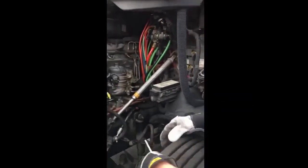My front and back spring mounts are properly mounted and secured - not cracked, bent, or broken, not missing any hardware. My leaf springs are properly mounted and secured - not cracked, bent, or broken, not missing any hardware, and there's no signs they shifted. My two U bolts are properly mounted and secured - not cracked, bent, or broken, not missing any hardware. There's no signs of rub marks and no shiny threads on the end of the bolts that would indicate cross-threading or looseness.